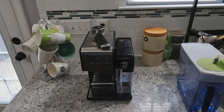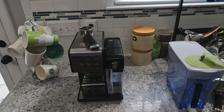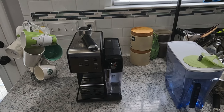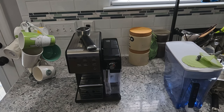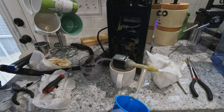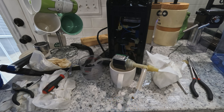One big clue is that there were no water leaks anywhere I could find — no water on the countertop ever, so I felt pretty safe there were no leaks. And if the pump works, then our problem lies somewhere else. What we know at the moment is that our pump works, so there's water being pumped from the tank through the pump through the exit valve toward the boiler unit. So now we turn our suspicion to the actual boiler unit or a valve on the boiler unit.